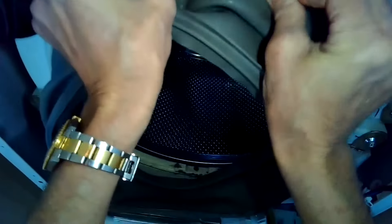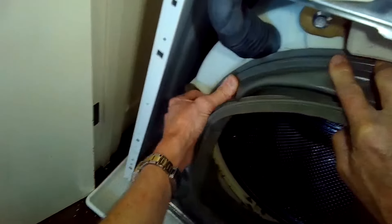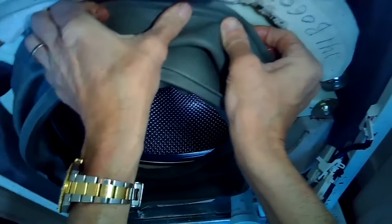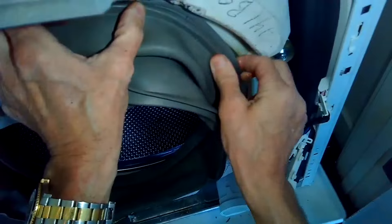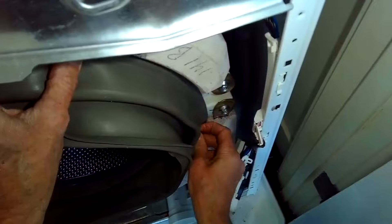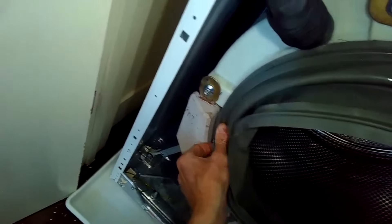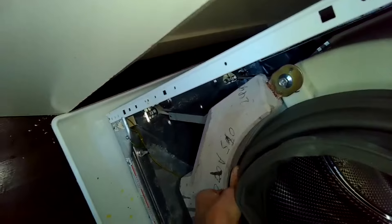Make sure the top piece — the one with the triangle — is at the 12 o'clock position. Push it in under that rim, then keep going around making sure it stays on. Go over to one o'clock, push that in; two o'clock, push that in; three o'clock, push that in. On this particular one the boot is rather small and you have to stretch it out over the tub, which is tricky. I ended up using the customer to help me — they held it at the nine o'clock and three o'clock positions while I finished at four, five, and six o'clock. Had I not had help, I would have needed clamps to hold it.